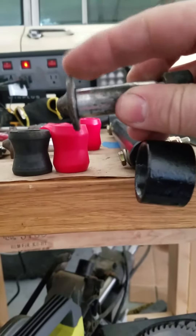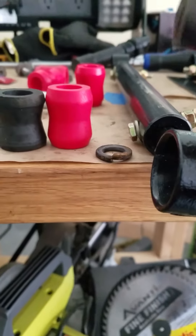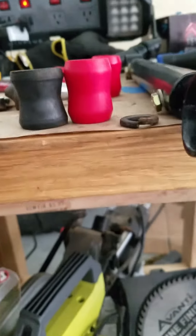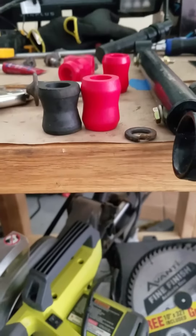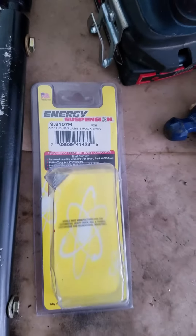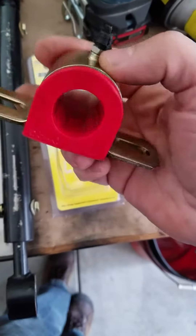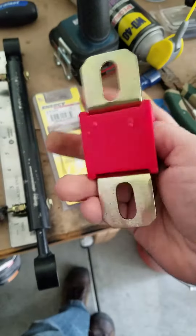The way these work is this built-in area is a washer. And I just realized all I have is a lock washer for the other side, so I'm missing a washer that needs to cover the surface here. I'm going to need to get a few of those. I got these from AutoZone — it's like $3 for a pack of two. One-inch size sway bar mount bushings — let me see if there's a part number.